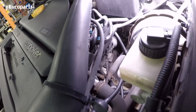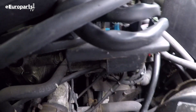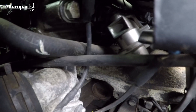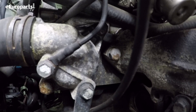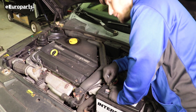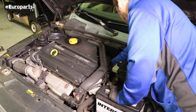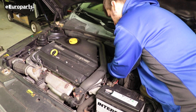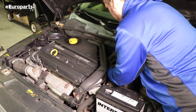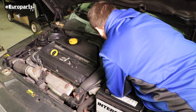We'll have the pleasure — or mispleasure — of working down in here next to the engine. You can see the top of the coolant hose going into the cylinder head, and this is our thermostat housing. There are two bolts that hold on the thermostat housing, and there are two 10mm bolts holding a stay and an electrical ground to the outside of it. Go ahead and remove those 10mm bolts first. We've got two 10mm and two 13mm, and we should be able to pop this thing off.